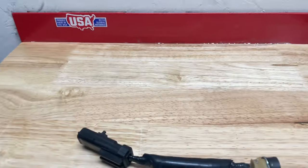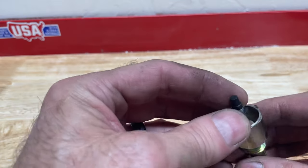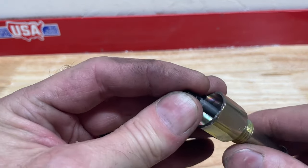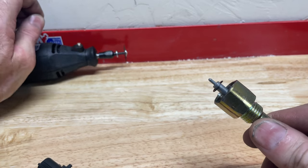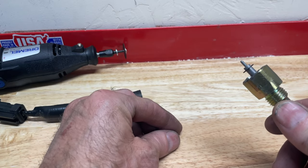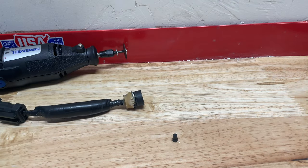You can see this piece here — this is how it works, it sits on this little tiny piece. You're going to have to take this entire thing apart when you go to put it back in. This is where the trick comes in: I actually use the shielding from a 12-gauge wire to attach to this thing to hold it in place, and use it to maneuver it into the right spot.